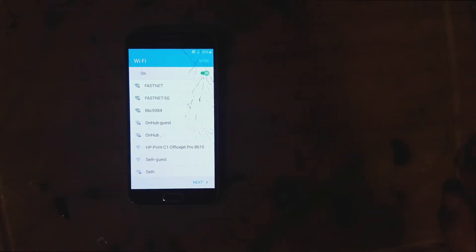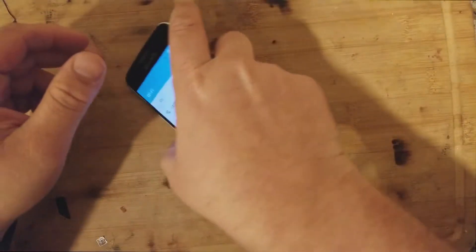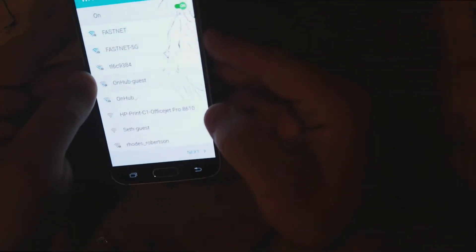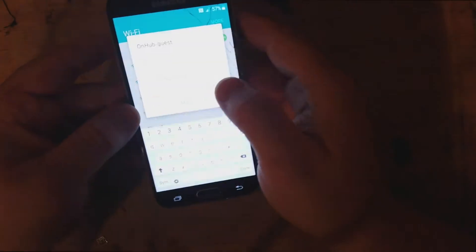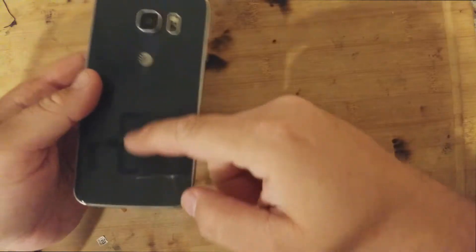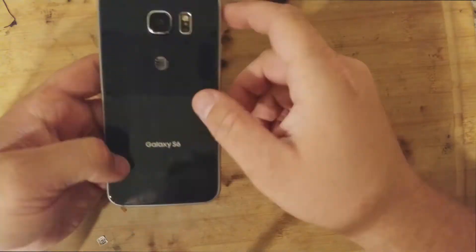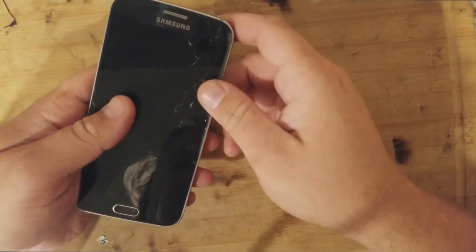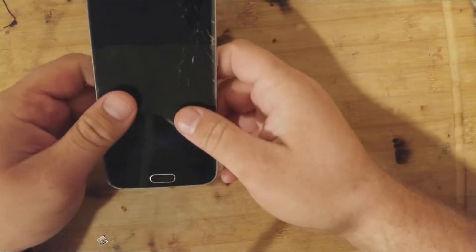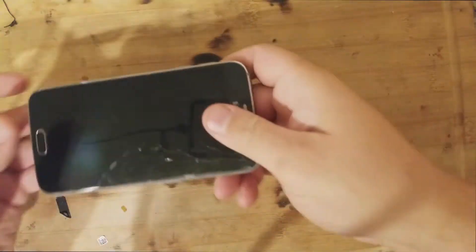First step is to get out your heat gun and warm up the back of the display, but I have my hot plate over there, so we're going to warm that up on my hot plate, and that way I don't have to do that, and then I'm also going to warm up the front. If you're interested in how to do it with the heat gun, please watch some of my other videos. Basically, you're going to want to warm this up hot to the touch. With a hot plate, I just have it at 100 degrees Celsius — just let it get warm, hot to the touch, nice and gradual, so it's a little bit easier.